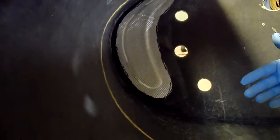I'll come in with the 3M high strength blister repair, and I can fill in anything there's still like gaps or whatever, and bring it out so it's just shy of being flush. I don't want it to be proud at all, because that stuff grinds kind of hard. And then I'll finish it off with Rage Gold, so it'll work really good. And that basically deletes these vents.